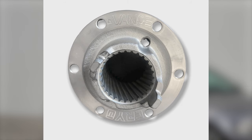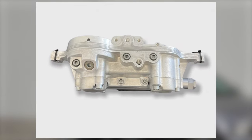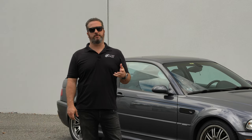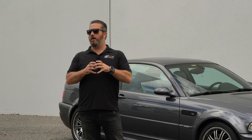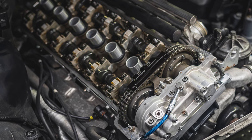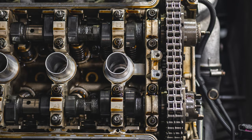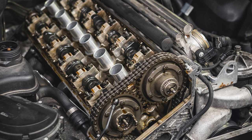We did a cryo hub — there's a hub on the end of the cam that has some studs that break off and wear over time. What Dr. Vanos provides is they buy an OEM hub and then they cryo treat it, which makes it super strong. It's just one of those things you need to do with the S54 to make it more robust — something you can do when you pop the vanos off, since the hub is accessible right there. We've actually had cars with a noisy motor where a tab from the hub broke off and was inside the motor. We recommend it now on all of them. There are also some cam bolts that come loose that we replace when we have the vanos off.